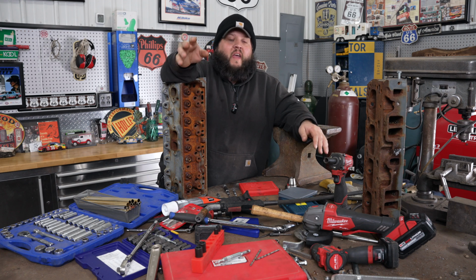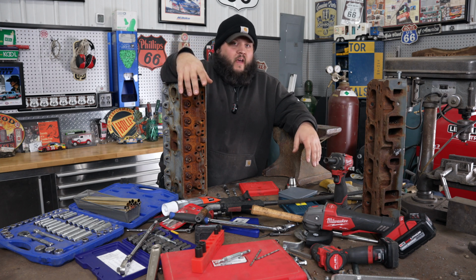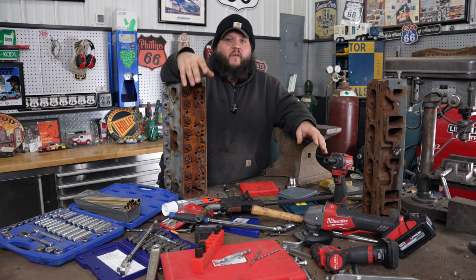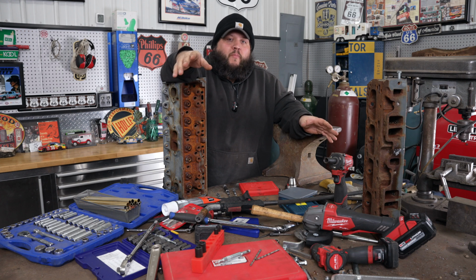I fought and fought these. I thought this video would be quick and easy. You know, it's kind of all staged bolt extraction. Hell no. This was a pain in the rear. I broke almost every extractor I have. It's just unbelievable the amount of troubles I've had with this. The whole setup was broken bolts inside the cylinder heads. I used soft grade bolts, just ran them in with the impact until they broke basically.